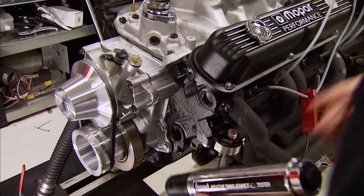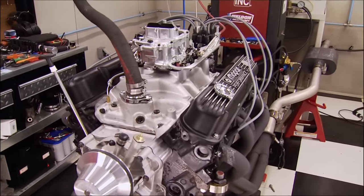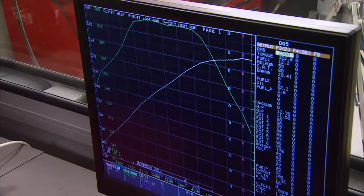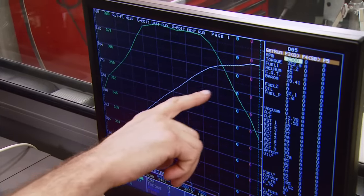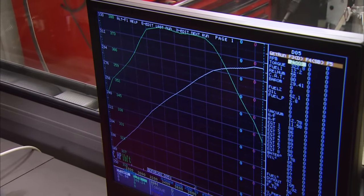Now let's see what Mike and his knack for timing can do. He actually backed the timing off just a hair, and the result is 381 foot-pounds of torque at 3,800 RPM. The torque curve is straight up, flat across, and then down — right in the operating range of the camshaft. Power is a nice steady ramp all the way up, no drops or dips, just really consistent. Can't beat that.